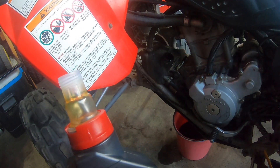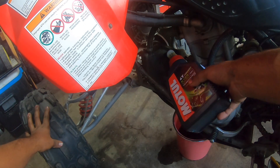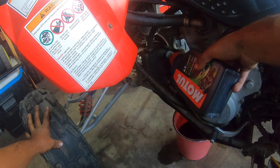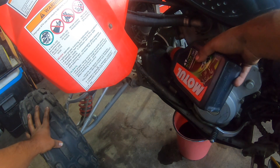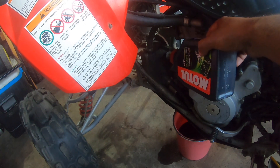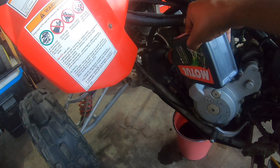Open that up and start dumping it as well. They should take about two and a half quarts since I did an oil and filter change. I'm going to try to put this whole bottle in — if not, I'll need to pump some more into the engine via the dipstick. Since this bike does have overflow into the airbox, I'm going to put a little less — maybe about halfway on the dipstick.